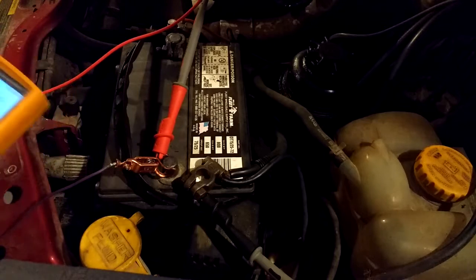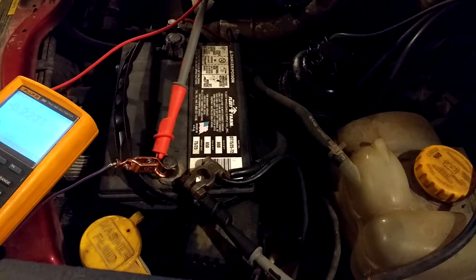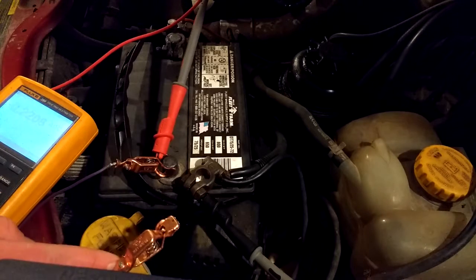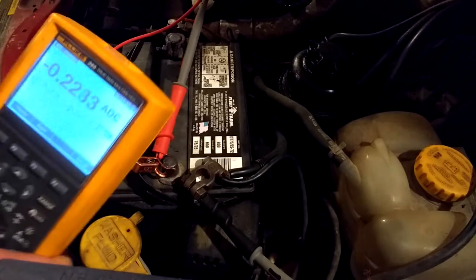The other reason I originally hooked up that jumper wire is because when you disconnect the battery, some cars — I ran into this on a 2016 Isuzu — the computers won't reset until after the ignition is cycled, so it will actually have a higher amp load until you cycle the ignition. Over the course of 12 hours I had about 5 times the normal draw because I had never turned the key on. Also, with the running headlights on, it has a tendency to pull more than 15 amps and will blow the fuse out of the multimeter.